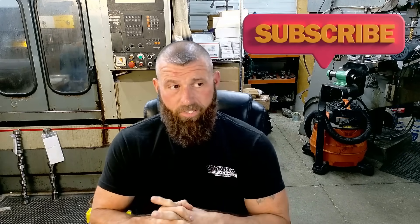I had one cam come in — the profile was a little bigger than they wanted and they wanted me to bring the duration down a little bit. It's a small base circle ford, which I still don't understand — we'll talk about that in a minute. Then I had another guy, same week, email me pictures asking 'is this normal?' He has a 980 base circle small block Chevrolet, so I'm assuming he's got like a four inch stroke crank and a small block Chevrolet, so they had to make a small base circle.